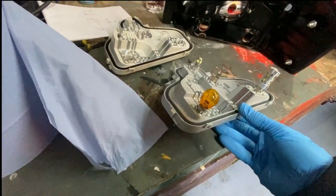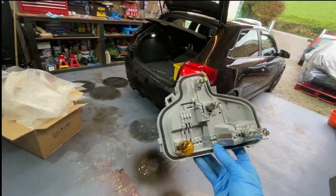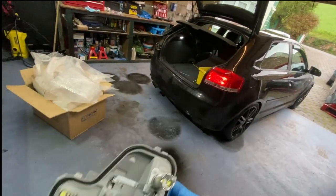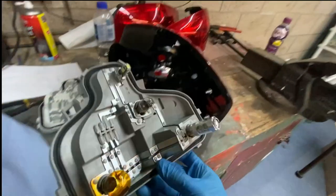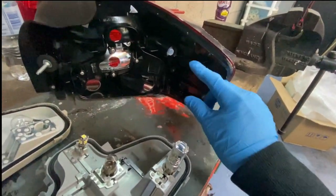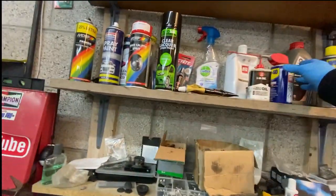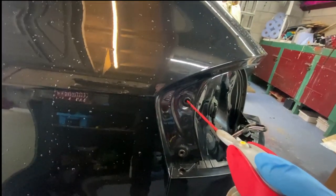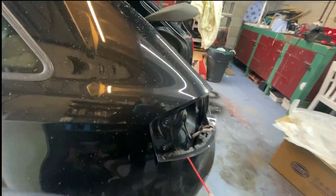Make sure you put the clusters in and test them before you put everything fully on - I've done it before where I put all three lights on, took them off, put them back, took them off again. It's just better to put the cluster in, see if it works, and then go from there. To fit the light, make sure you grease up the pins a little bit so they fall inside the grommets easier. Use WD-40 - spray it inside so the metal pins slide right in instead of catching on the edge and pushing the grommets into the car.